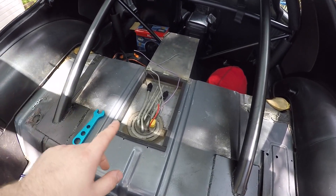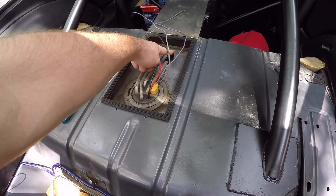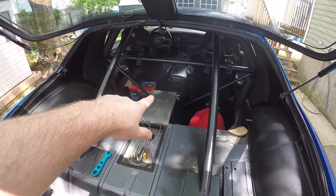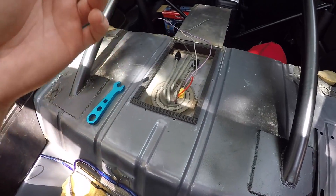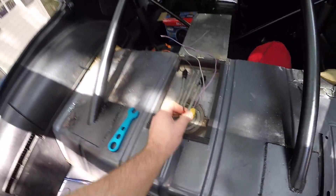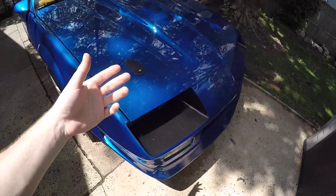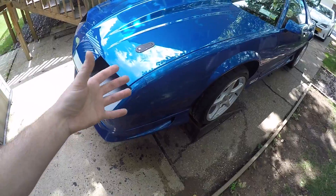I think I'm going to wrap this one up here. I'm going to link all the parts I used in the description like I usually do - the two AN line nuts, the sleeves, the male-to-male dash-6 fittings, and my little dash-6 AN line wrench. Next video I will be wiring the pump up - we're going to run these wires up to the front of the car. I'm going to tap a 12-gauge wire off the battery fuse block to my new relay, because this pump does use a lot more power than the regular 255 - that's why I upped the gauge on the wiring.